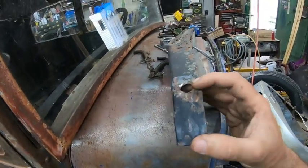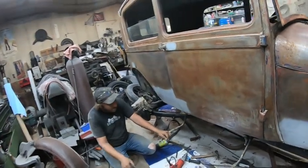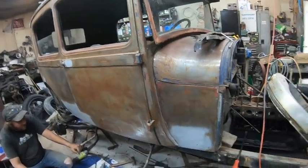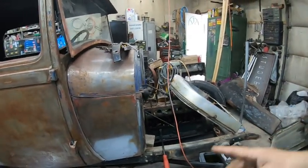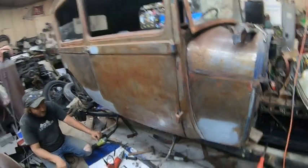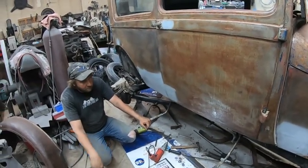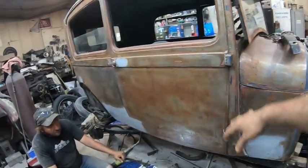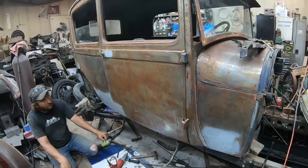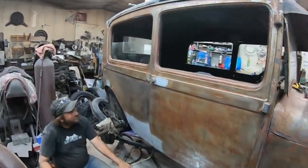This is going to keep us from trying to fix all this crap. We might actually have this done in the fall. I can't see why not. So the first thing we'll do — after the old motor's gone — put the flathead in temporarily, get all the mounts in, then pull it out, start cleaning up the frame. We're just going to wire wheel the frame, give it a nice paint job — brush, spray can, whatever. Start on the body anytime, give it a big orbital sanding, give it a very good epoxy primer, then high build the crap out of it, give it a little block sand, and get new glass.